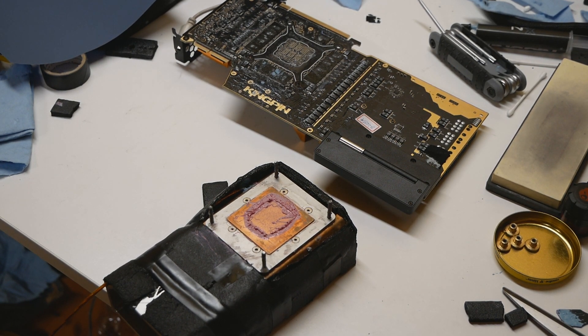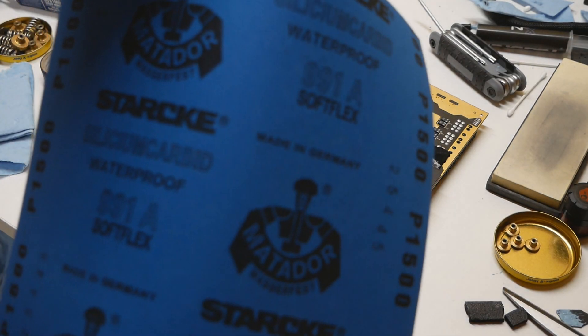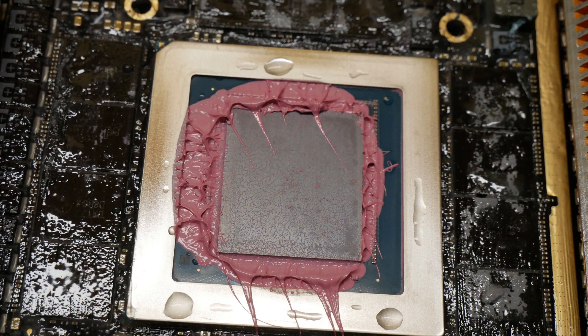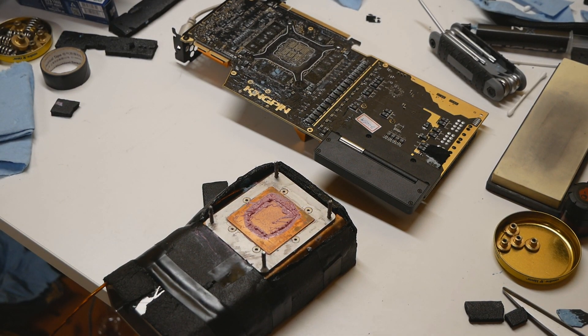This method is actually from Biso Biso — he told me to use a long glass panel like what I showed in my previous video on this topic. He uses a specific sandpaper by a German company called Matador. I've never used these before, but they seem very good for lapping electronics. They give a much better outcome than the 3M sandpapers I've used so far. The finish looks pretty much perfect — I cannot see any issue in the thermal paste spread after detaching the cooler.